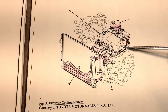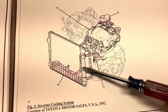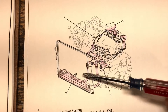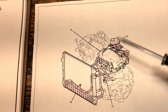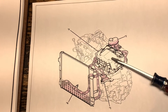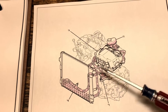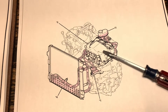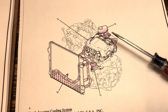Here's a look at the drawing. As I said, here's the reservoir, the supply line to the pump, and then the lower quarter of the radiator is completely dedicated and separate from the engine cooling. Two separate systems are used because the cooling demand on an internal combustion engine and on these electronics would be quite different — in degree and in what mode cooling is required. These electronics could get quite hot quite quickly while the engine wouldn't even be up to operating temperature yet, hence the two separate independent loops.